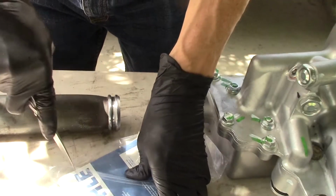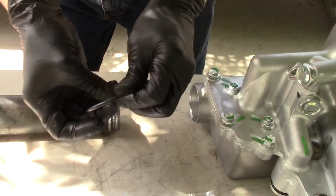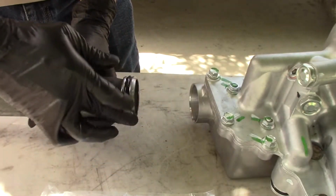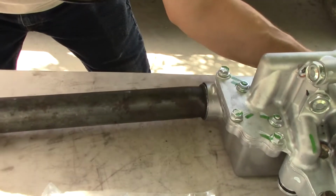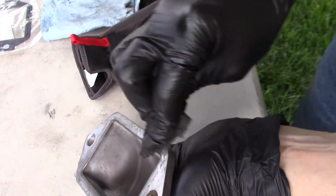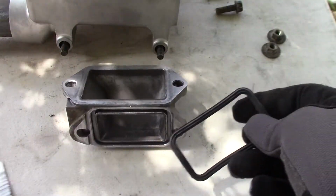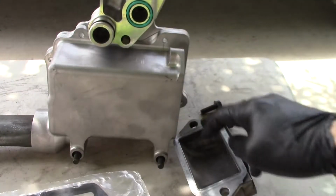Alright, I'm going to put this gasket on here. Let's lubricate this gasket, or the O-ring. Add some lube around the edge of this. Inside of this. That should assemble pretty easily. There we go, perfect. A little more Scotch-Brite and WD-40 on this. Cleaned up both sides of this. This gasket goes between there and the block. It's ready. And this gasket goes between here and here.